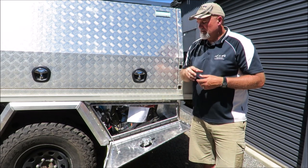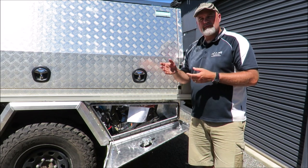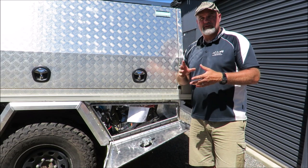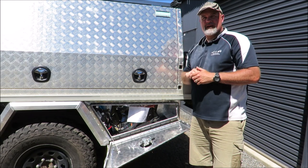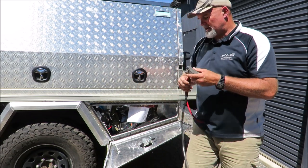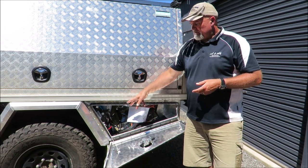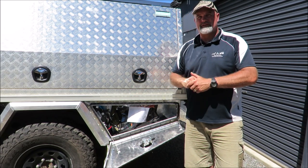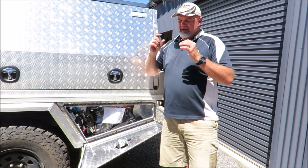The other thing to consider is your Anderson plug rating. I had a 120 amp plug for the Thumper Max. I did run the Thumper Max through a 50 amp Anderson plug and it got a bit warm — I was worried about it melting on the west coast in the middle of nowhere. So when I put the Thumper Max in I put the 120 amp Anderson plug on — it's huge and a bit hard to work with, difficult to get the cable in and to click together. When I went to the ARB I went back to the 50 amp Anderson plug, which is more than enough for the ARB compressor.